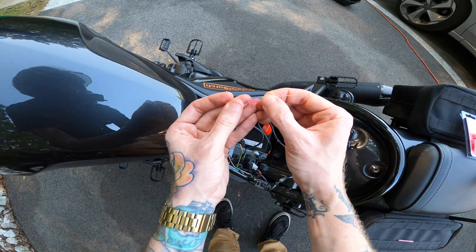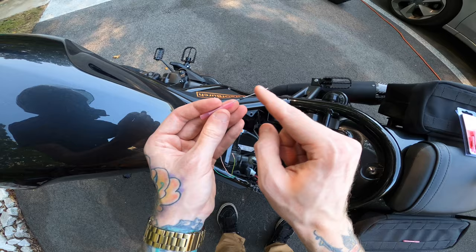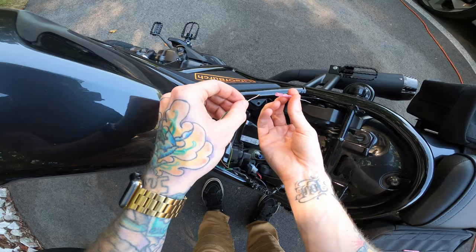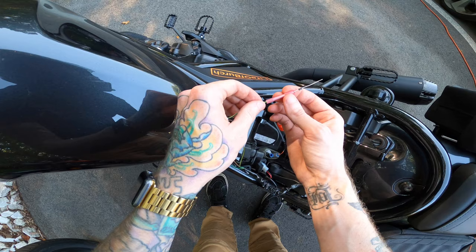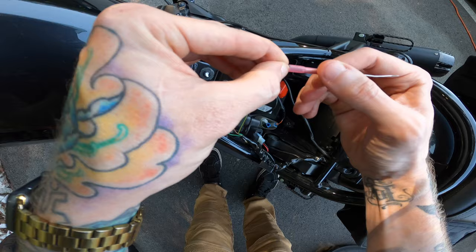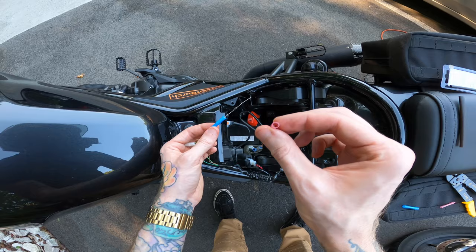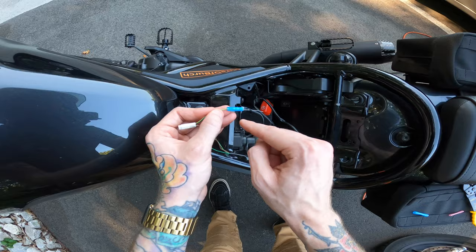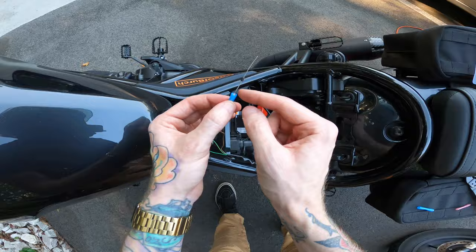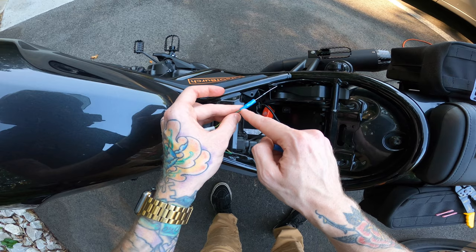Essentially we stick the diode in one end of the butt connector, making sure it goes through the middle, then stick the wires in, crimp it down in the middle, and heat it up with the heat gun for a weatherproof seal. It ended up being pretty clear that both the diode and the wire weren't going to fit inside the smaller pink gauge butt connector, so I had to use the bigger blue one. The issue with that is it only shrinks down a certain amount and won't do the weatherproof seal around this wire, let alone the skinny diode. So after realizing it wouldn't shrink down enough, I just cut off the flared end towards the diode — I didn't want to melt it down and still not have a seal. So the lesson learned: you could honestly just cut both flares off and use a regular butt connector, which is simpler.